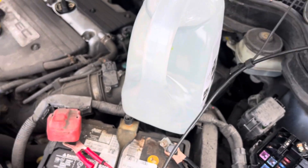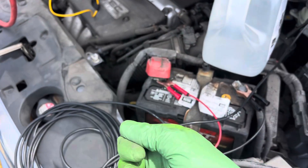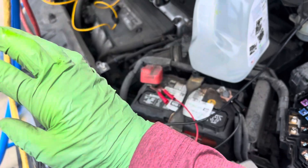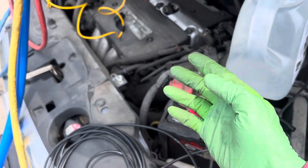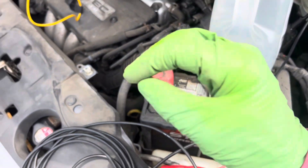So that's an easy one. You've got to get down there and find out: is it a connector backed out inside a plug, did somebody do an oil change and knock the plug off, or is it the actual field coil itself that is open?